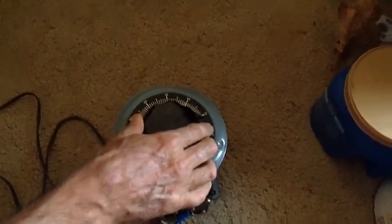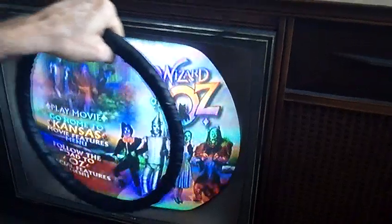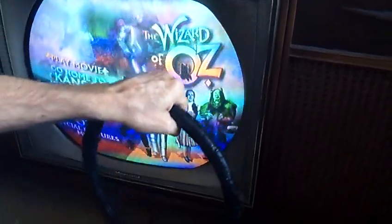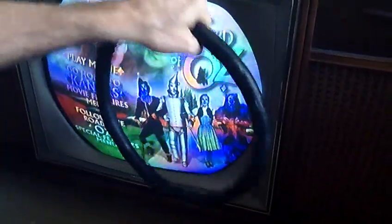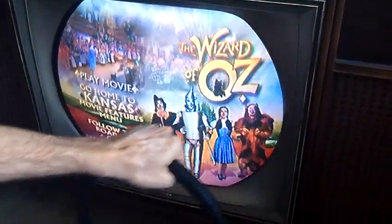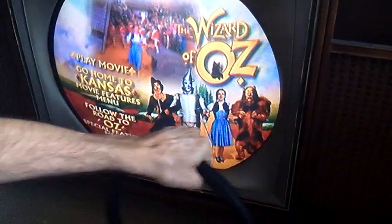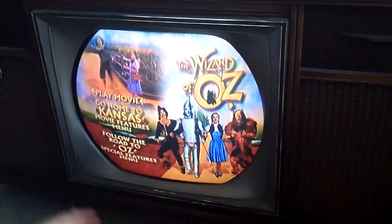You can see it's really getting into it now. Here's the variac — I'll slowly turn it down. You don't even have to move it usually, but I'll rotate around and slowly bring the voltage down, which is essentially the same as pulling the coil away from the screen. I'm just bringing the voltage down real slow, making this magnet weaker and weaker, still an alternating magnetic field, all the way down to nothing. And we're out. So there you go — that's how you degauss, how you demagnetize the screen.